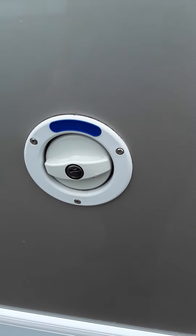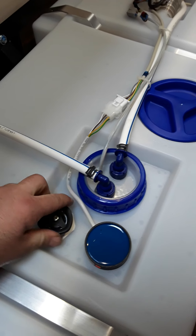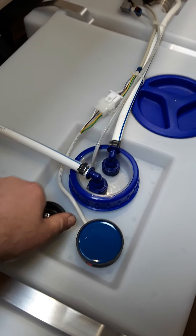This is where you fill your van with fresh water — simply put a garden hose into it and fill away. Before you fill your fresh water tank, it is underneath the living area — you have to lift the cushions. There is a black knob which is your tap for the fresh water tank. Make sure it is closed — turn clockwise to close it and anti-clockwise to open it. Be very careful, it only needs a few turns to open. This is very easily broken so try not to over-tighten, and just a few turns anti-clockwise to open it, otherwise it can come out of position in the bottom of the tank.